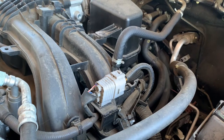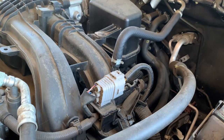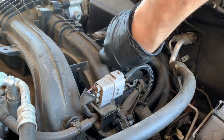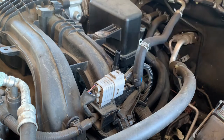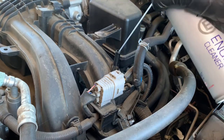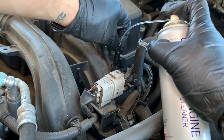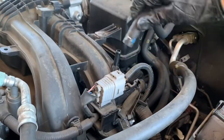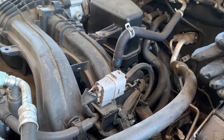The first way is if you just want to do it quickly or you're not too confident pulling stuff apart. I'm just going to pull a few of the hoses off — take the clamp off, take the hose here off. Give the can a shake; it should come with a straw, so be careful not to lose that straw in the engine. Give it a spray down there. The engine is warm — it was running — and Subaru actually recommend doing this a couple of times.